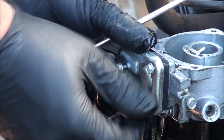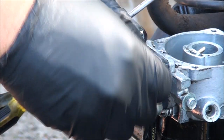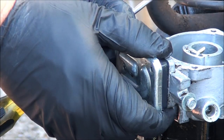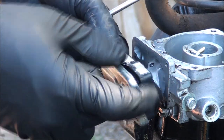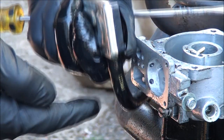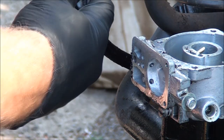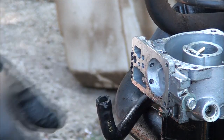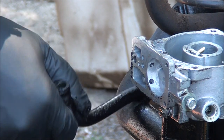These are pretty long bolts. There are three springs that you have to keep track of, and I try to take it off with the black plastic part first. I forgot to remove the vacuum hose off the bottom here, so you'll want to disconnect that too. You'll also want to inspect that hose to make sure there's no cracks in it or anything, because that's what operates your fuel pump off of your engine vacuum pressure.